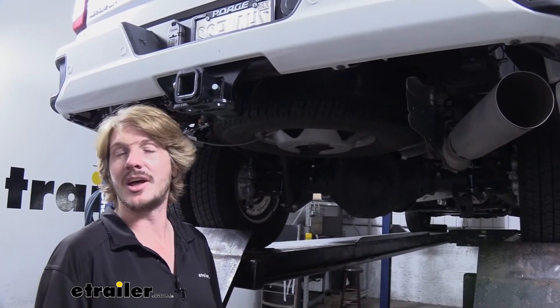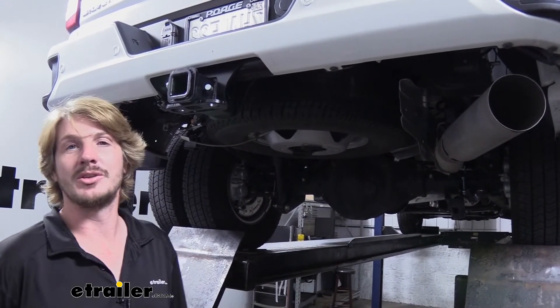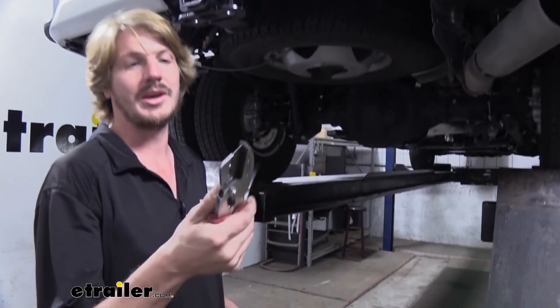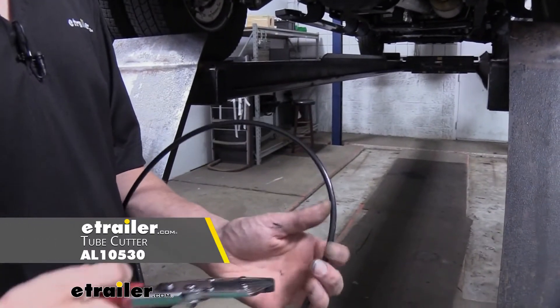So we're going to have to cut it — basically cut it into two separate lines. Your passenger side is usually a little bit longer than your driver's side because we normally mount it over here on this side, but that's all up to you where you want to mount them. When cutting your lines, it's important that we use an appropriate tool so we get a good clean cut because these are going to poke into quick connect fittings at the airbag.